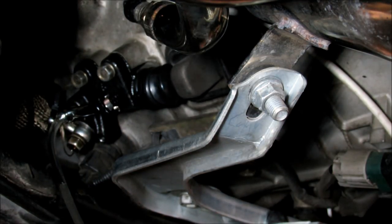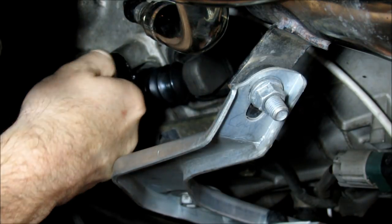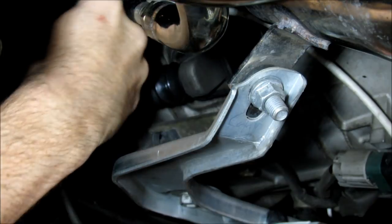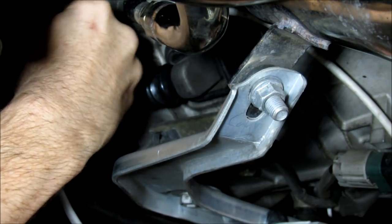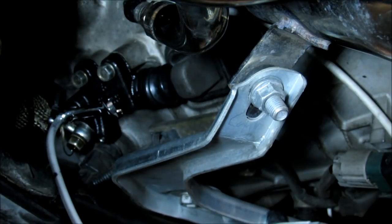All right, you wanna go ahead and hold it to the floor? Okay, see how she has it held to the floor? We're going to turn this to the left, and there should be some air bubbles that come out. See all those air bubbles? And then you're going to crack it back to the right and repeat the process. All right, go ahead, start pumping it.